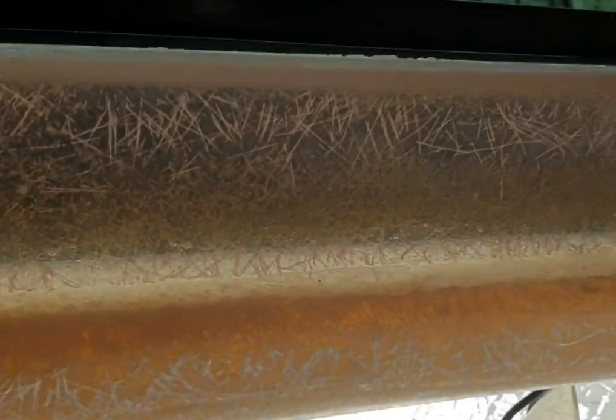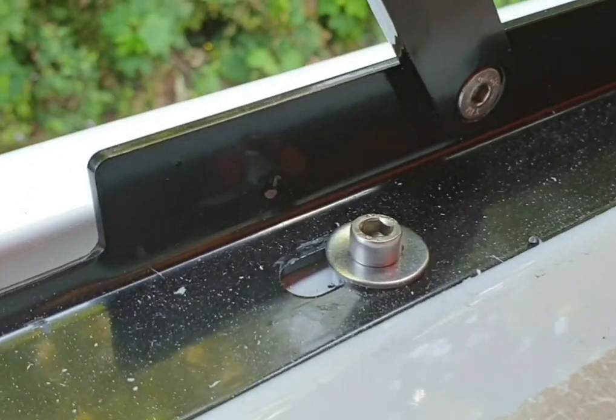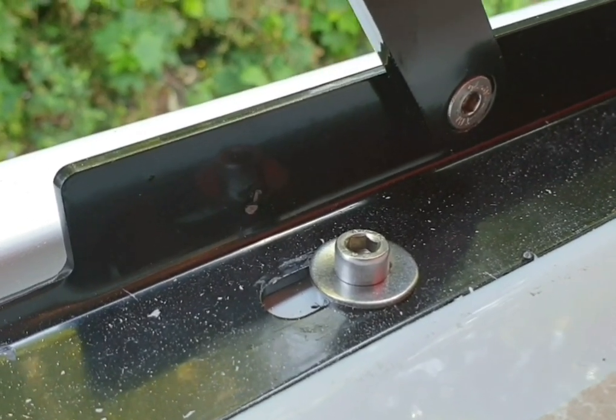Right, so I got a bit ahead of myself without recording anything. So I think where we last were was putting this hinge on. I have the rivet nut in for that bolt there. And we measured on this hinge, from the centre of that end, centre of this hole, to the centre of that one, which was 22 inches I think. So then they can move about to adjust it, and when you've got it in position, you put one through there and that'll lock it.